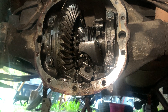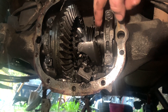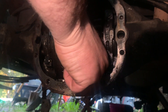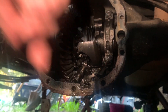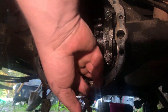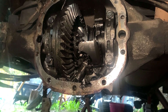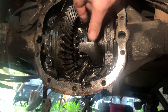This is a General Motors G80 Positraction rear axle, and this is an exploded view because it exploded. You can see, instead of having spider gears in here, there's a clutch system. There are spider gears that floated around the outside, but you can see the clutches and discs in here which would lock this axle together. There's a pin that would go through the center. The mechanisms in here — wow, that's seen better days. Even the carrier bearings are coming out. This whole thing is toast.